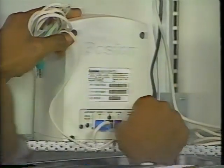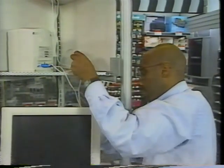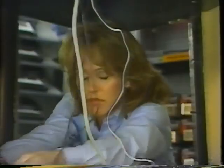Attach the cable with one purple end to the purple analog jack on the back of the subwoofer. Run the green end into the base of the fixture. Make sure that the collar ring is back on the center support pipe before you do. Place the speaker's power supply in the cabinet of the fixture and plug it in.